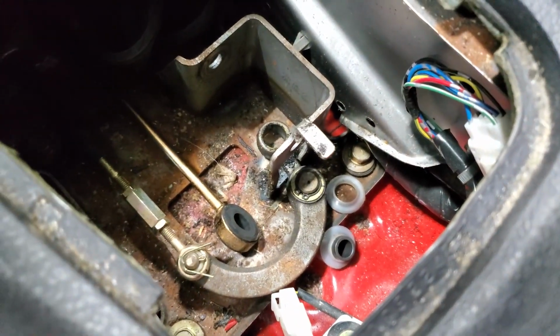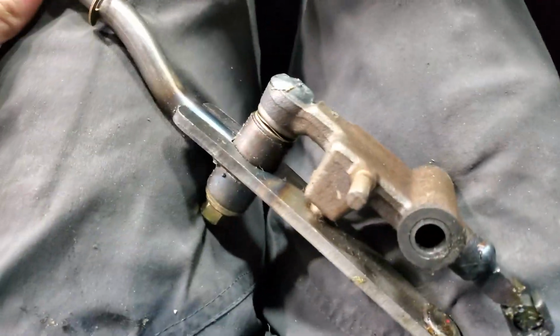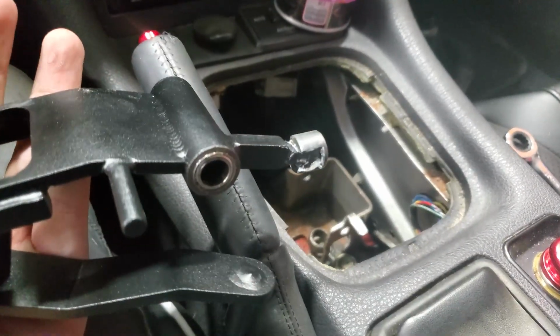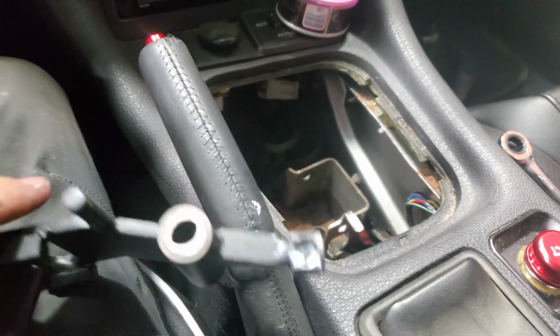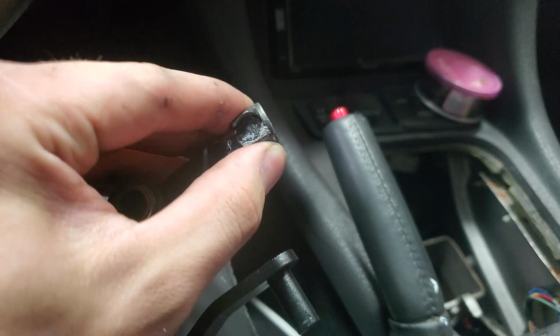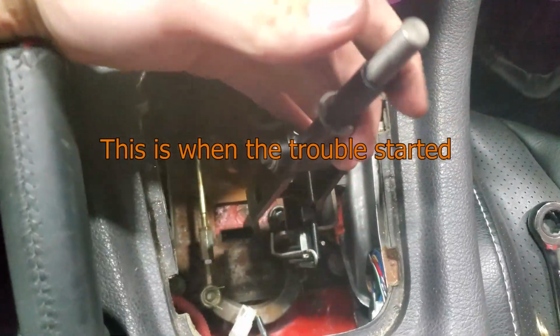Okay, got it out. Down there is disgusting, so I'm going to vacuum it. And then honestly, it's just throw the new one back in. This is a bolt and a cotter pin, and that's it. So, all right, in my endeavors, I found on the bottom that you need this piece, so that needs to be transferred over from the stock one.